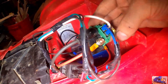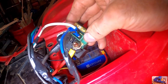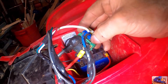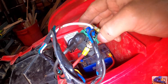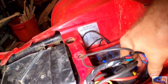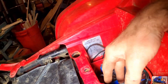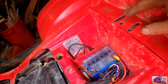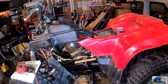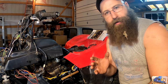I forgot to mention — I'm going to recommend that he fills the terminals completely with silicone once he has everything finalized and knows he doesn't have to unplug it again, just to prevent shorting. Then tuck all that in there nice and neat, pop the seat back on, front fenders on, and he's ready to do some wheeling. Right on, we got her fixed!